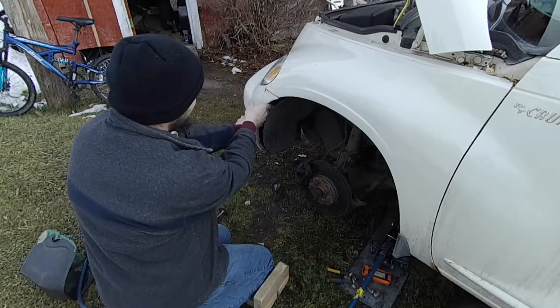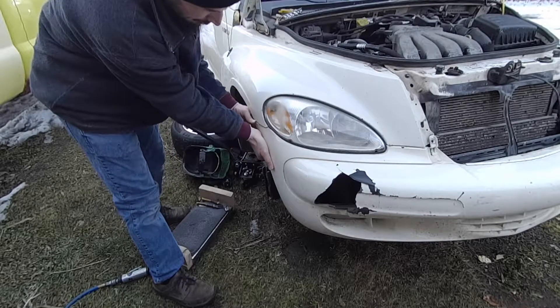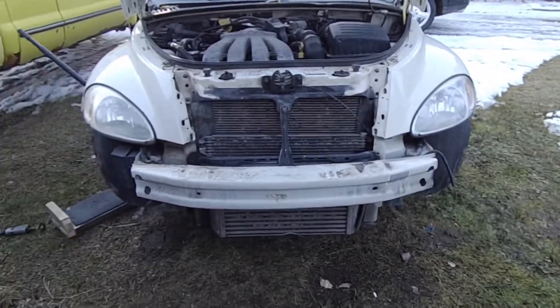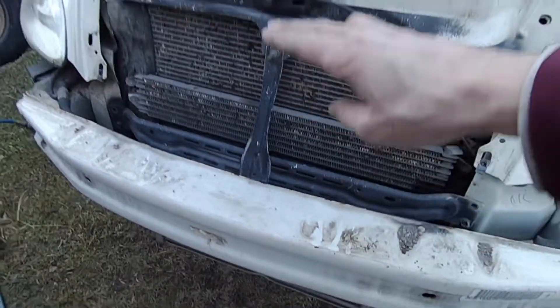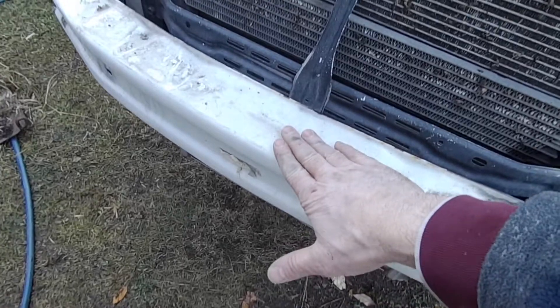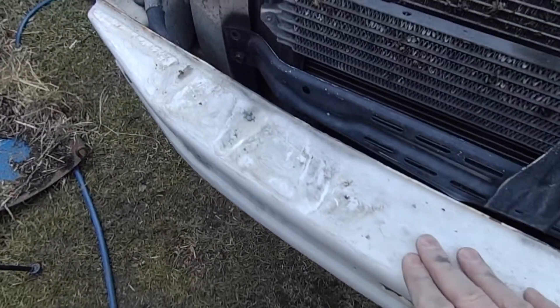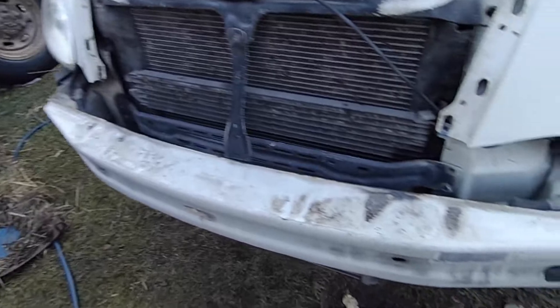Got the second one and now that'll pull down. Got this side free as well with no damage to the bumper. That's what we're going to mount everything to, and I might even be able to put the grill back later. I'm going to make a bracket going up here for my pulley for my winch cable to come down and lift the blade. The winch will be bracketed right to the top of this, and I just have to make two U-shaped brackets to hold the plow arms on the end of the frame rails. This is called a bumper reinforcement — I'll take this original one off and put it aside, then take a spare one I have in the shop and weld everything up on it.